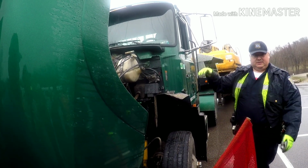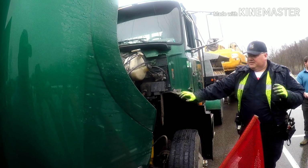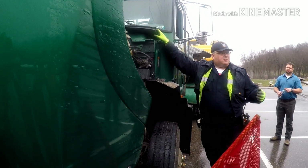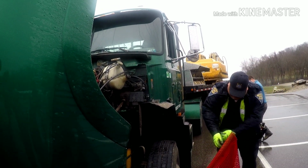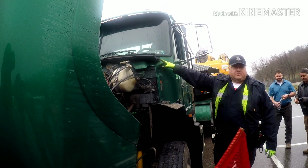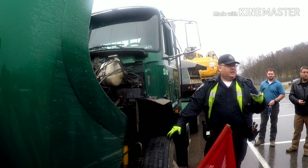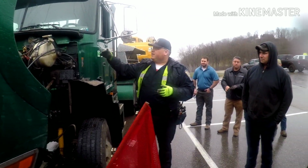How about one about that long? Well, is there intersecting cracks to it? Then it's going to be all right for now. If it's straight, yeah. Intersecting leads to your problems. So, wipers, make sure wipers work, both sides. Make sure the washer systems are topped off, have washer fluid, because not having that is a violation, basically a defective washer system. So making sure that's good.